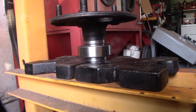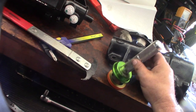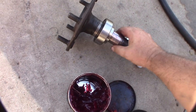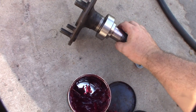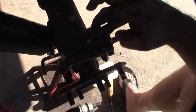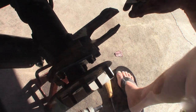Alright, I need to get this mounted. I've got to pop a new seal on here. One thing I'm gonna do is lube up the seal, because once this thing is going, the oil itself will keep the seal lubricated — but you don't want a dry seal rubbing on metal, it will tear it up in two seconds. I'll grab a rubber mallet to bring it in a bit more, but I still need to get my disc brake on there. So you have the circle spacer, the caliper bracket, and then that little square bracket.